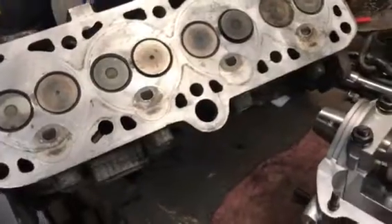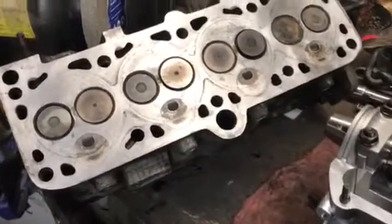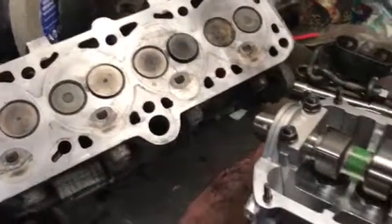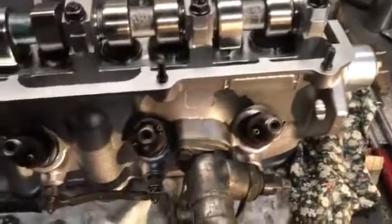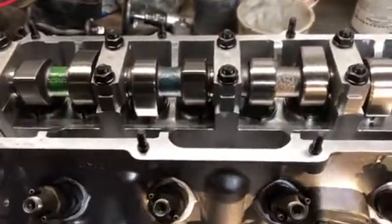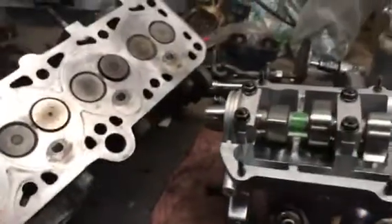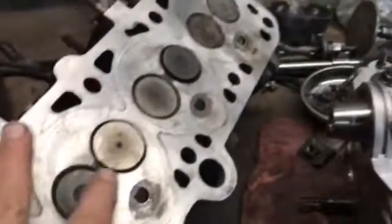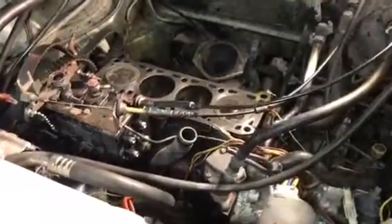But why the cracks? Well, it's my fault. I'm convinced this is my fault. I've actually overhauled this engine before, and I always had a habit — until recently — that when I start these motors up, even in summertime, I'd walk back in the house, get a cup of coffee, play with the wife and kid and dog. What I don't do is start them up and just put them in gear and drive, because that puts an awful lot of load on this aluminum head. This thing should warm up long before you put it on the road. But this new house I live in is right within two minutes of the interstate.